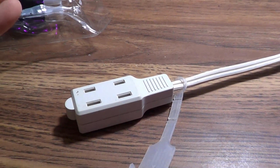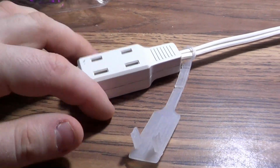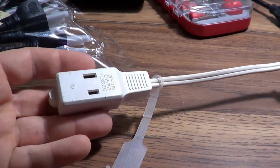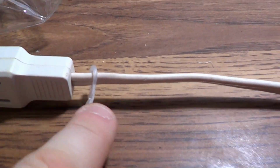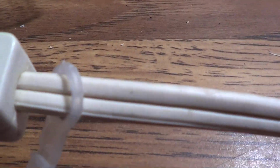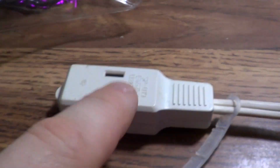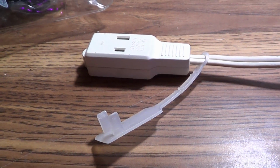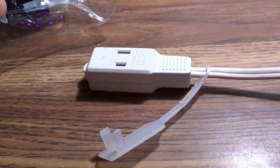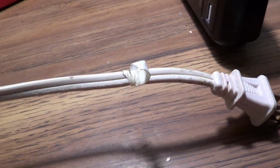And because it's low current, because you're talking AC adapters here and not something like power tools or anything, the current issues would not be a problem with the conductor that was used in the cord. The big issue is these are from the 90s. They're almost 20 years old, so I have to start wondering, especially if I start seeing signs that the plastic or the insulation is yellowing. This thing is yellowing just a little bit, but not very much. When plastic yellows, its chemical composition is changing, and it often becomes more brittle. So I don't want really old stuff handling 120 volts AC like this.